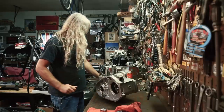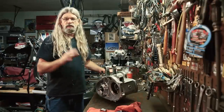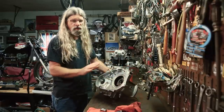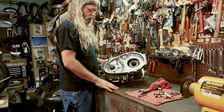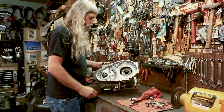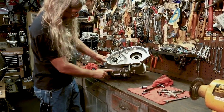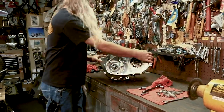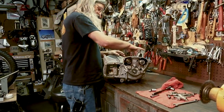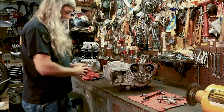We've paid particular attention to making sure we have all the fasteners. I'm going to double-check one last time before I try to take the two halves apart. A lot of times when you're taking something apart you start pulling it and then you notice you forgot one screw. Just a review: one there, one there, one there, here, here, here, here, and the two that were here and here, and last but not least the two we just took out with the screwdriver. Now we're ready to split the case.